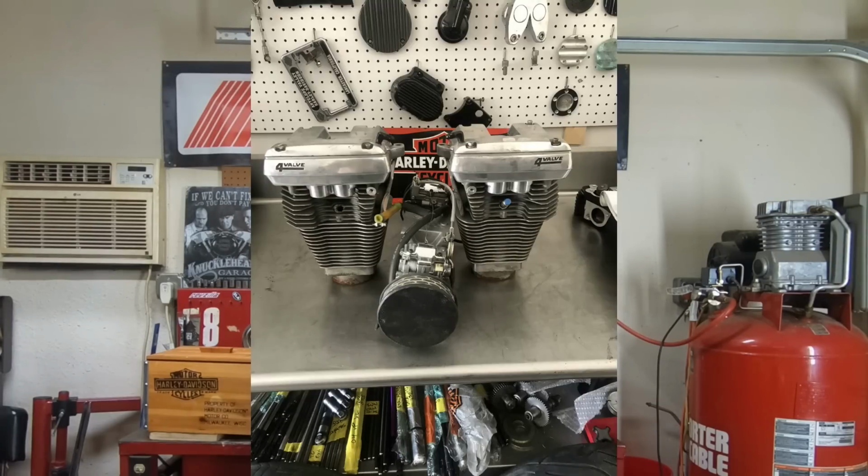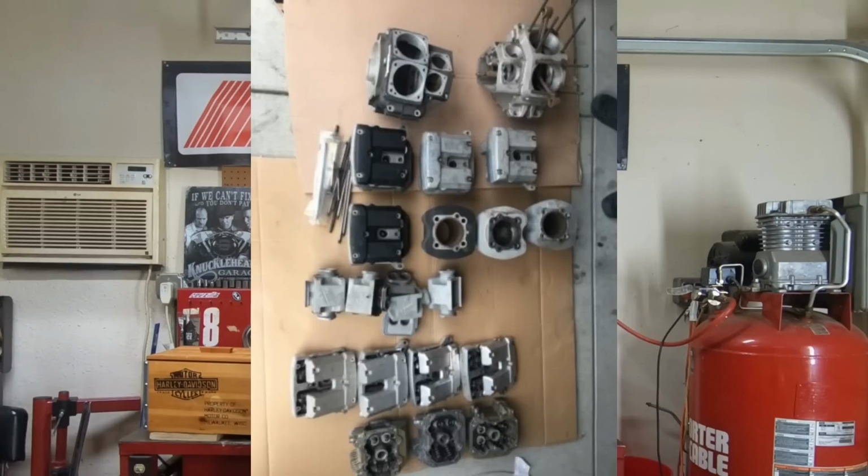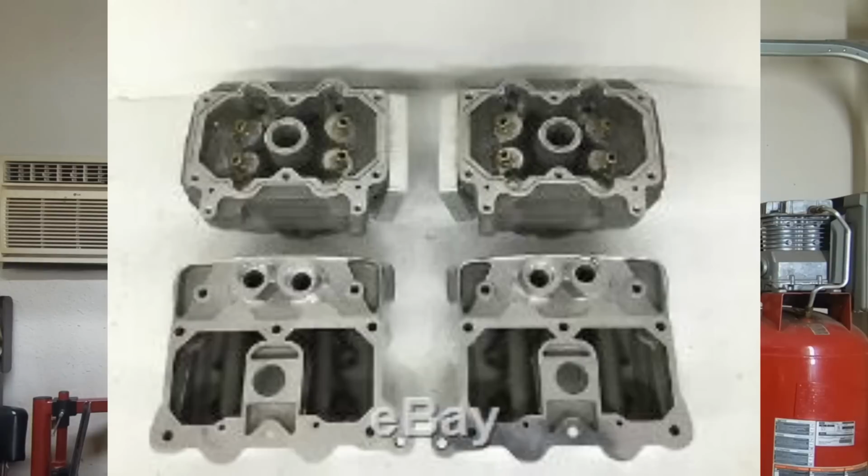It really was a neat concept. It had a lot of potential. The only problem with it is it just wasn't cost effective for the average Harley-Davidson owner, especially considering the average owner could just go out and use the same basic formula with porting your 2-valve heads, big bore kit, high compression cam, and still come out just about right in the neighborhood and make the same power as you could with the 4-valve head. Now, that's not to say using that same common formula and pairing it with the 4-valve head wouldn't make a big difference, probably about 15 to 20%, 10 to 15 horsepower, but the problem is you're already going to spend another $3,000 on top of the $3,000 to $4,000 that you already put into the motor. And most of the time, that doesn't even really include the labor, especially when you're considering porting the heads.